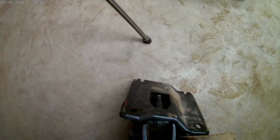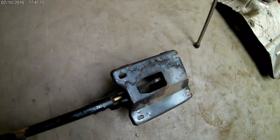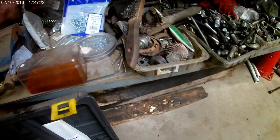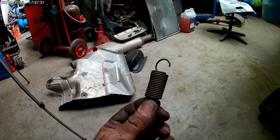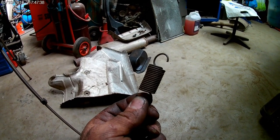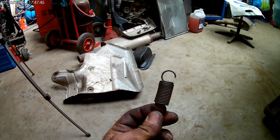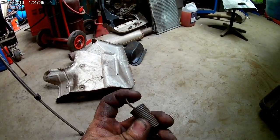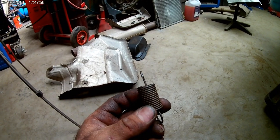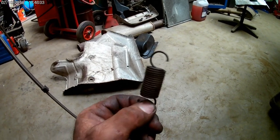I had this problem last year, so what I did - it was a bit of a dodgy repair - I added an extra spring under the steering wheel attached to the brake pedal to help the brake servo spring bring the pedal back up when you take your foot off. But that spring was a bit too stiff, plus it's an extra spring that's not supposed to be in the system. The brake pedal feel was like a tractor - really stiff.